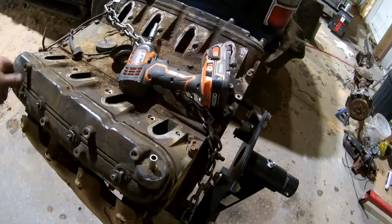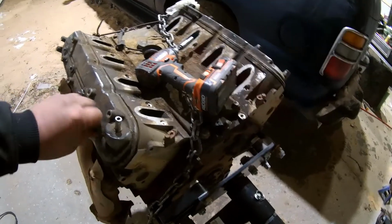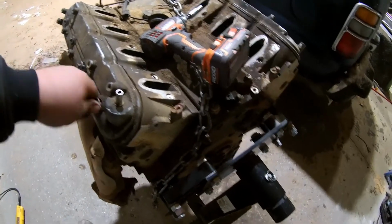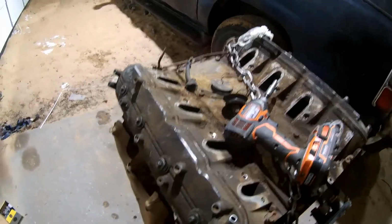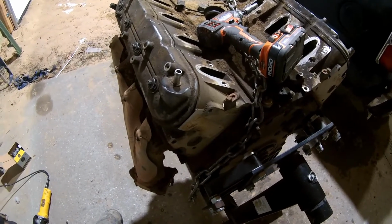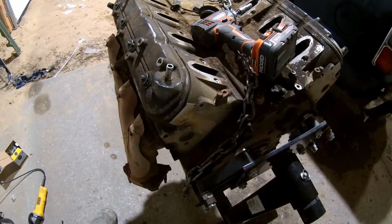So yeah, big update for the car. I'm tired of working on that piece of shit straight six. Next video I'll probably tear this thing down, see how the bottom end is on it, and if I do find a bad lifter, then I'll probably order a new set of lifters and file the rings on it and throw it back together and put it in the car.